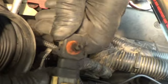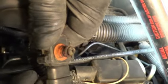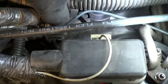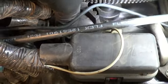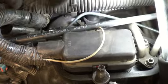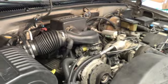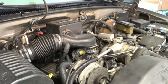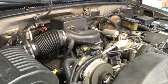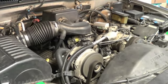Okay, so there's that map sensor, and that gasket there is in poor shape. Is there some little clips that kind of supposed to... They're on it now. Okay. There might be something that's supposed to hold it down, but I don't know what. Well, we're hoping for a little better result this time. Map sensor snapped into place. Oh yeah, much better result.